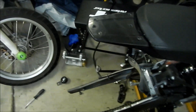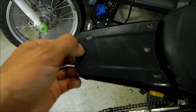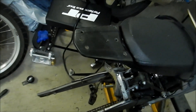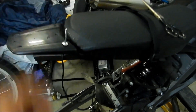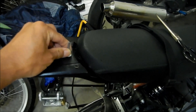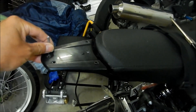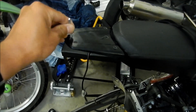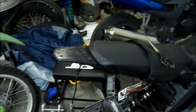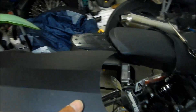There are the six holes I drilled. I tried to clean them up as best I could — this stuff does not drill very cleanly. Let's make sure our rivets fit. The rivet goes on top like this — perfect, looks good, that's how they're all going to look, and it doesn't stick out anywhere. Now the next thing we have to do is drill the corresponding holes in the new extension fender.